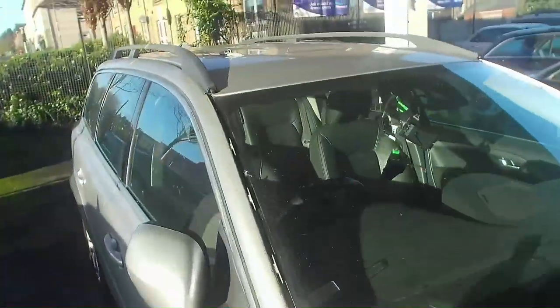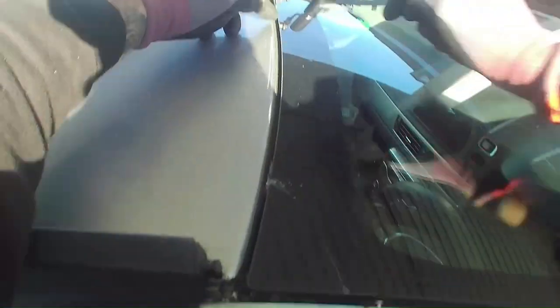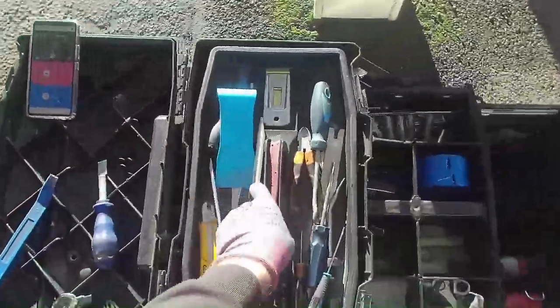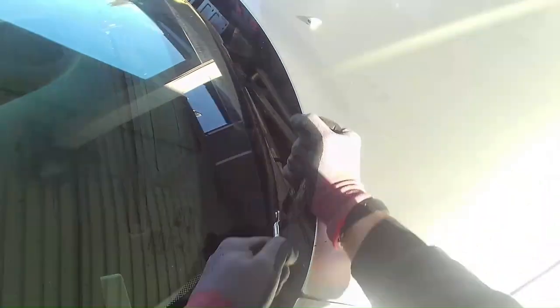Just give it a little sharpen up and see if we're getting all the way round. Just be careful not to scratch any of this panel here because this is exposed. Down here is not too bad because you can prime it — it's covered once you've finished the job. But you don't want to be scratching any of your paintwork — it'll just start rusting over time. Just keep it tight to the glass. A third size of blade should get right through the urethane bead along the top and down the sides. The bottom has a higher urethane bead along the bottom channel.